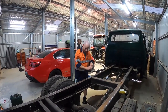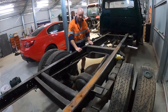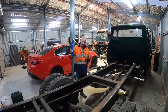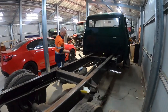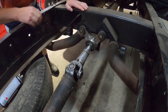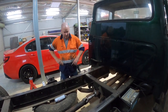Our little projects for tonight - we've got three of them. We're going to finish preparing this chassis; we've already done one side although it looks a bit dusty, and we need to finish the other side which looks rusty - it's just surface rust, it'll come off pretty easily. We're going to paint it on the weekend so all this has to be ready. We're going to grease our kingpins and shackle bushes. A huge job down here is the whole center bearing assembly that joins onto the tail shaft - this was really really loose. I've rebushed it, put new fresh nuts and bolts in, and that's ready to go. It had a lot of play in it - quite dangerous on these trucks as you can get a big drivetrain vibration going.